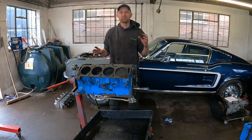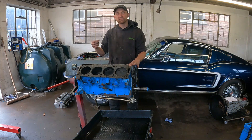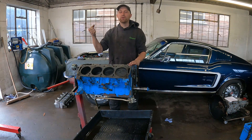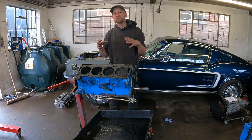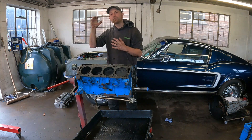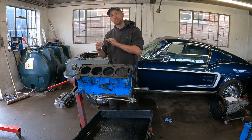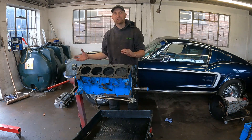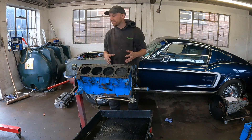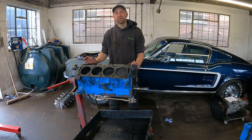Since the last episode came out — while we were actually working on this — it had a really bad smoking problem coming out of one side of the exhaust and no compression in number 8 cylinder. So when I took the rocker covers off and saw the hydraulic lifter was just flat out and the inlet valve wasn't opening, everyone's kind of agreed that what was happening — the inlet valve wasn't opening, so the engine was still doing its cycle. And when it was pulling down on the induction stroke the inlet valve was closed, so it was just making a huge vacuum in the chamber, which was actually sucking oil from underneath through the rings into the combustion chamber, compressing that, and then firing it out the exhaust on the exhaust stroke because the exhaust valve was still opening. So every time it was on the induction stroke, the intake valve was stuck shut because there was no push rod pushing it open because the hydraulic lifter wasn't following the cam — filling the cylinder with oil and then pumping it out the exhaust. And that's also why it's showing low compression — because it had nothing to compress. It was pulling down, couldn't get any air in, all that was coming up was a little bit through the rings. So that's why it's showing a low compression test — not the normal assumption you'd get from a smoky exhaust and low compression on a cylinder. It was actually just because a hydraulic lifter failed and it just happened to be the inlet.